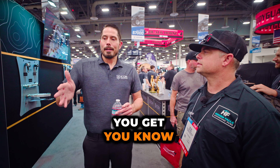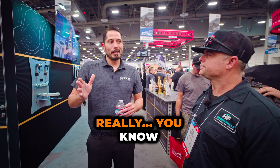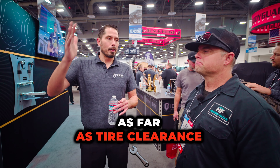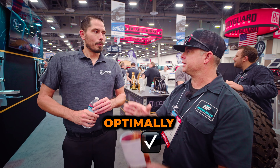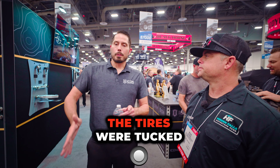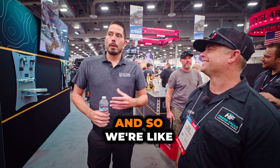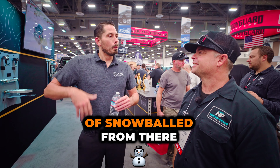Exactly. You get a positive offset where a few more millimeters would be money as far as tire clearance — that'd be the sweet spot to get the suspension to behave optimally. You get the tires to tuck nice up into the fenders. When turning, you have to do less trimming, stuff like that.